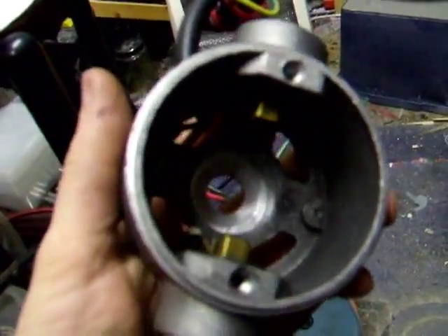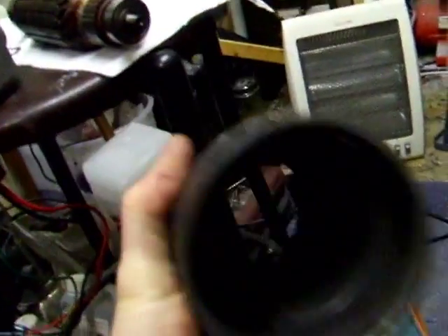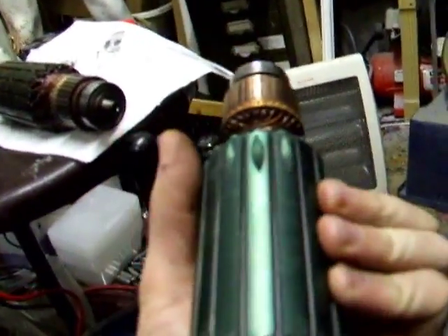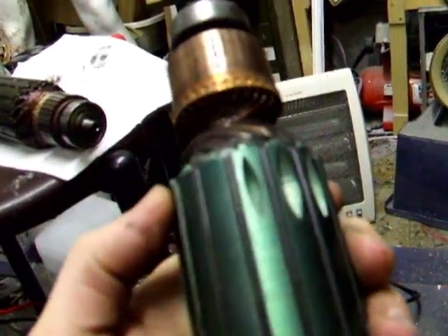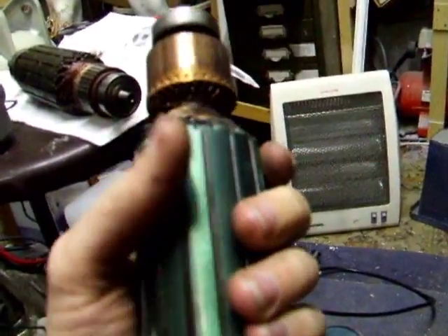The wiring is fine. The head's fine. The magnets are immaculate — there's not even any overrun of glue around the edges, unlike the Green Master one. There's a lot of carbon dust on the end plate, but I've never seen this in a motor before. The rotor's actually been balanced. They've actually taken V-cuts out — I don't know what that would do to the magnetic fields, but they've taken material out to balance the motor, to make it run better.